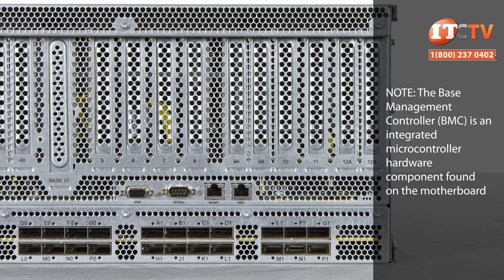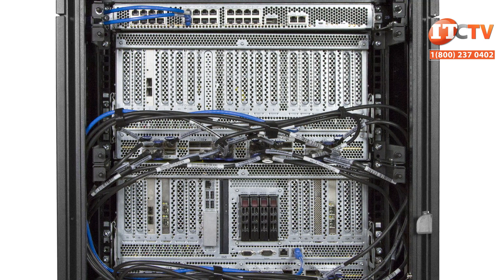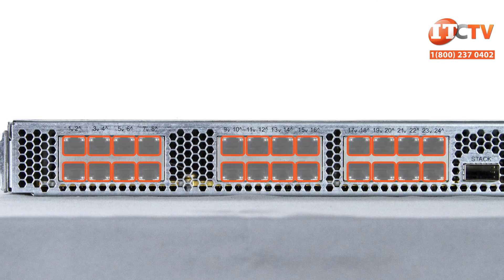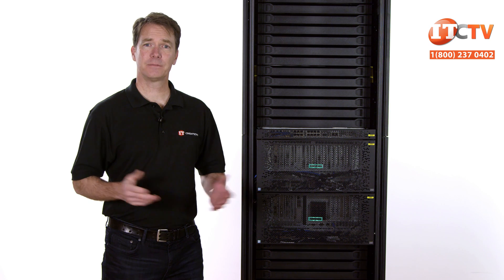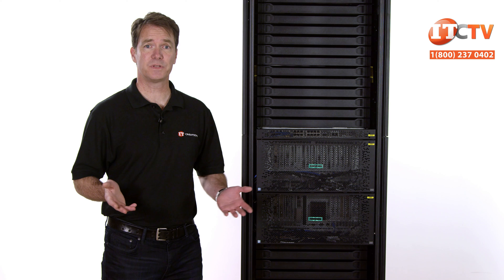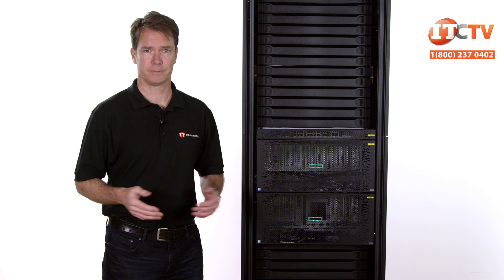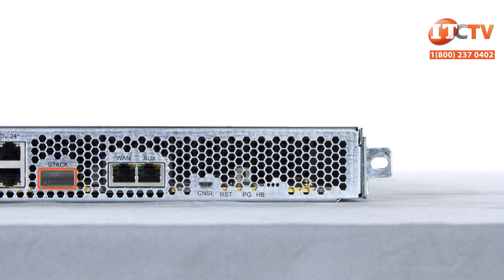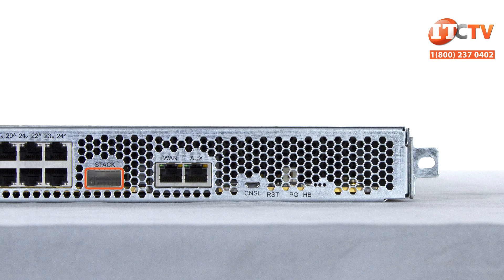Both the RMC and BMC are active whenever the system is powered on and are not dependent on the OS or operational status. Each MC990X system's RMC can power up individual server chassis, individual racks of MC990X servers, or the entire system. It features an internal 24-port Ethernet switch and can control up to 16 MC990X server chassis via a 1GB Ethernet port. The RMC also monitors environmental state including voltage levels, status LEDs, and access to the system OS console to run diagnostics, boot the system, address system BIOS, and initiate system resets — and it stores identification and configuration information. For increased resiliency, the RMC can be connected to a second RMC using the stack connector. Optional mass storage enclosures have their own management system and are not monitored by the system control network.